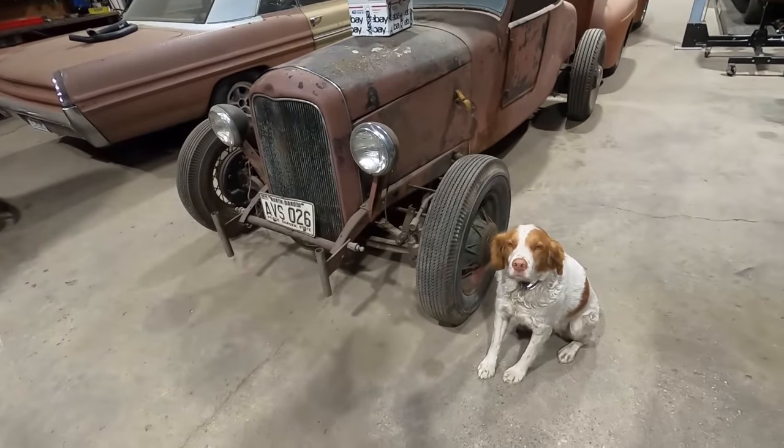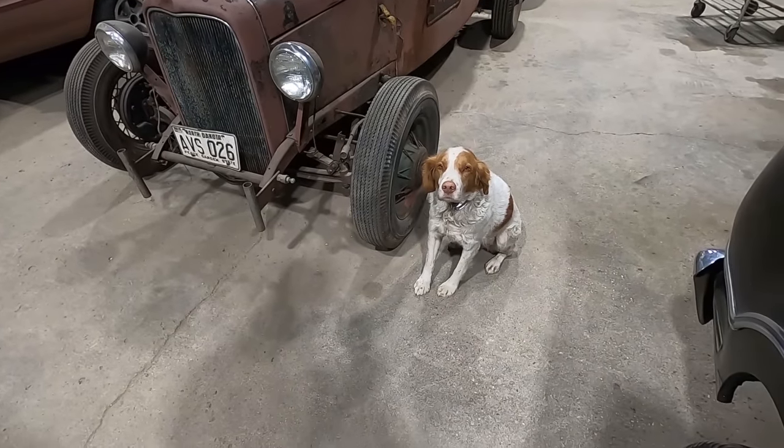They don't really make a drop spindle for these, which is weird, because they make a drop spindle for pretty much just GMs, because Ford's got that silly twin I-beam. You gotta get the dream beams, and they're super expensive, and they drop it about this far. I like Fords, '67 to '72 Fords. They're not a good way to drop them, unless you put something else underneath the front end. And we don't do Crown Vics around here. We did that once. No mas! Gonna run her up on the lift? That'd be great.